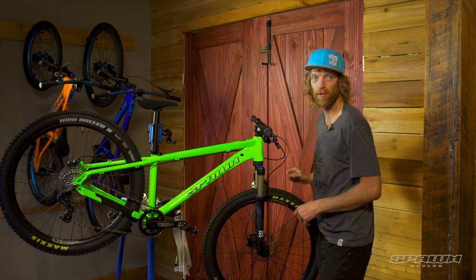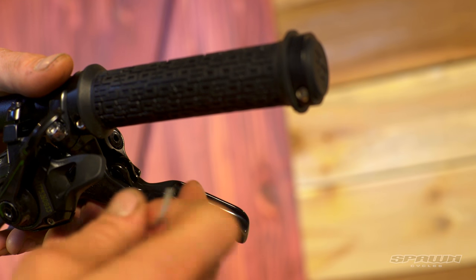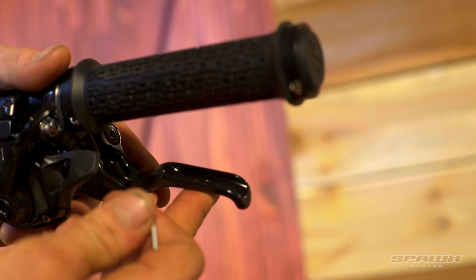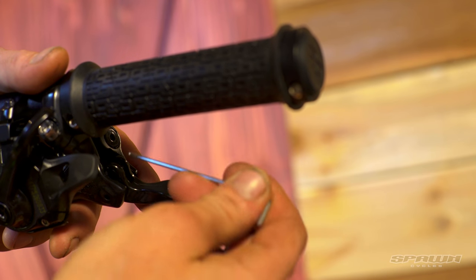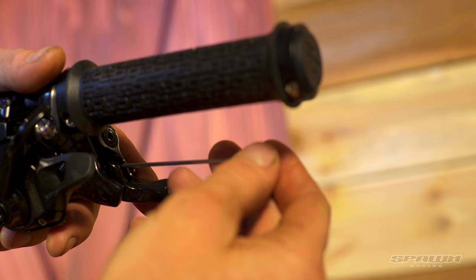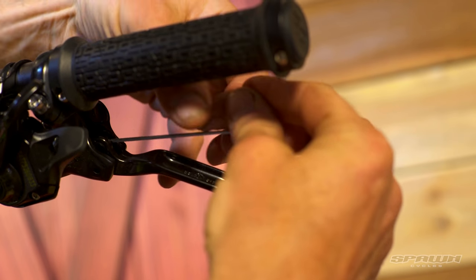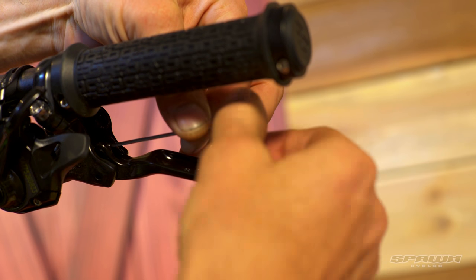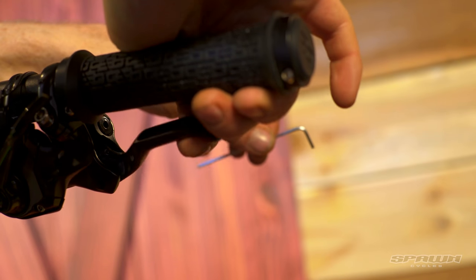It's shifting excellent right from the factory. A nice feature with these brakes is we've got some adjustment for the rest point for the lever where it sits. For smaller hands, using a 2mm Allen wrench, you can find the bolt there and unthread it to draw the lever closer into the bar for its resting position. Great for smaller hands.